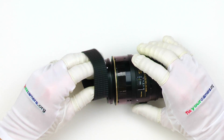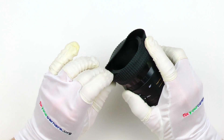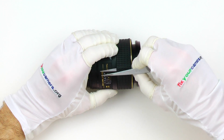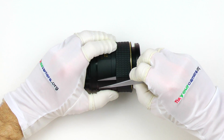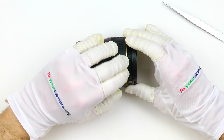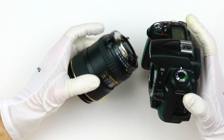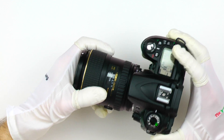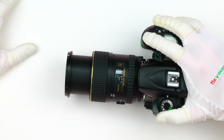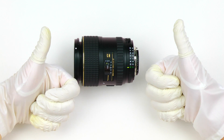Overall, if you take your time and do this whole process gently, you can do a much better job than some repair shops are doing — trust me on this one. Another way to remove nameplates is to use heat, but be careful because this plastic window will melt easily. I think 60 degrees Celsius, maybe 70, would be the absolute maximum. But I think alcohol is a much safer way to do it, and probably easier and faster too. If you have questions, please post them in the comments below, and subscribe to my YouTube channel for more photo gear teardowns, reviews, and repair tips. Thanks for watching and see you next time.